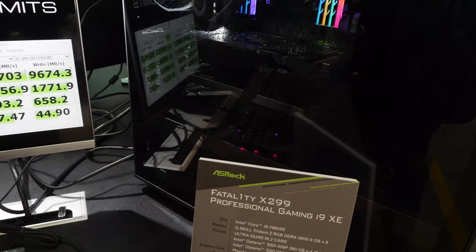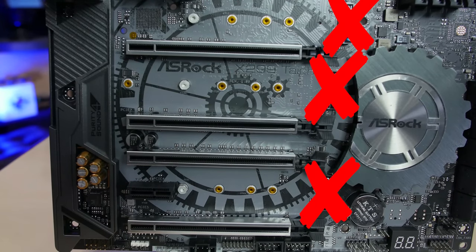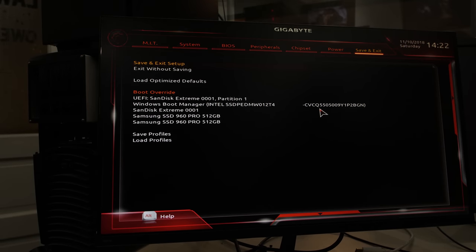It's really just up to Intel to do that. It is possible to set it up — I saw some really fast systems at Computex — but across all the motherboards I tested it's too inconsistent to recommend. The other gotcha is you can't use the M.2 slots on your X299 motherboard for RAID. Those M.2 slots are not real PCIe lanes — they're chipset lanes, just like their desktop counterparts — so you can't really use on-motherboard M.2 slots because they're not actually connected to the CPU. It will bottleneck at that same 4 gigabyte per second limit no matter how many NVMe drives you use. We can't get over 3.8 gigabytes per second real-world performance from X299 using the on-board M.2 slots.